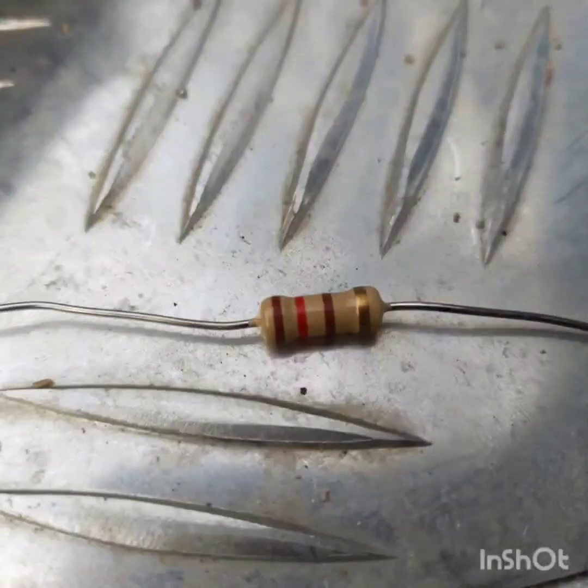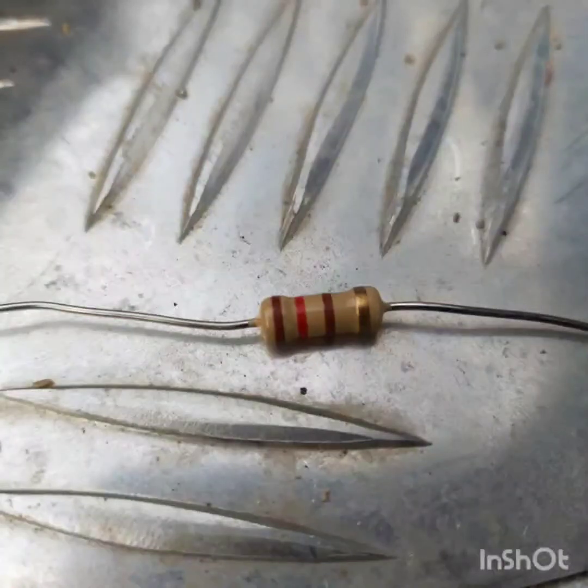I did a bit of research and I realised that because LEDs draw such a small amount of power, the vehicle actually wasn't recognising that there was anything attached to it. So what you need to do is to make the lighting wires in the trailer draw more power — you need to add resistance to them.